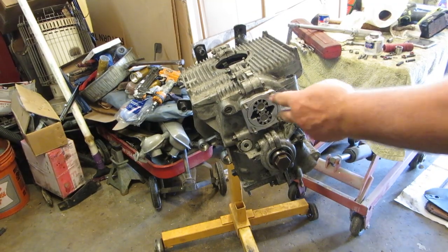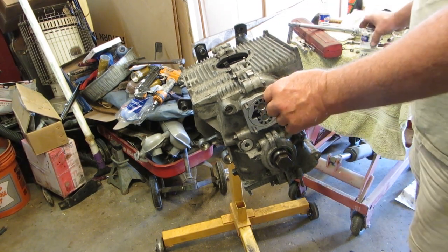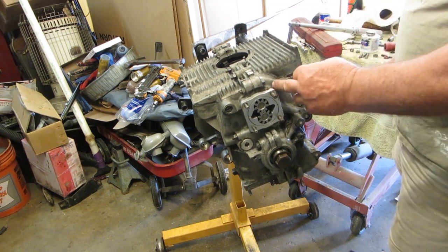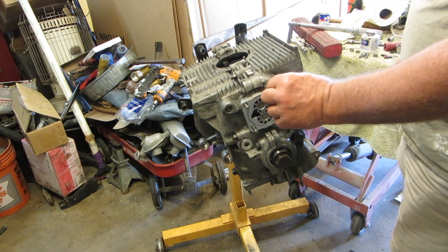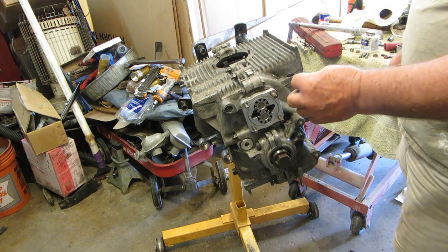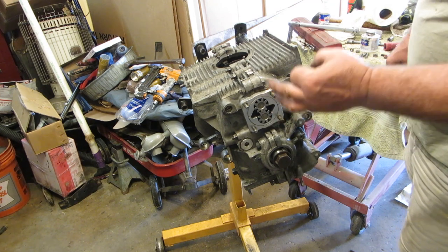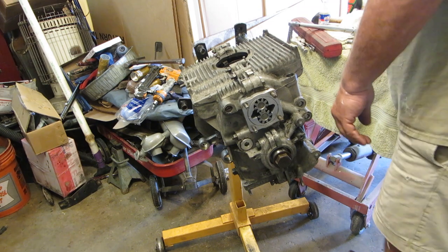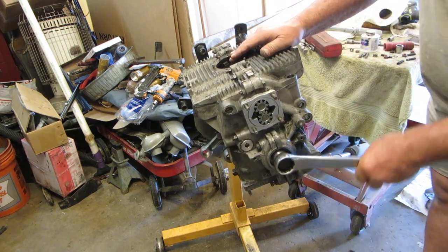All right, we have both of our gears in. We have our studs in. One thing about your stud is, if you keep going with your stud, it'll go all the way into the cam. So only go as far as the original stud was in there and leave enough out. The ones with the little collar keep it from going in any farther, and only the threads get in there. So again, we should be fine. There's no rubbing or gnashing of teeth.